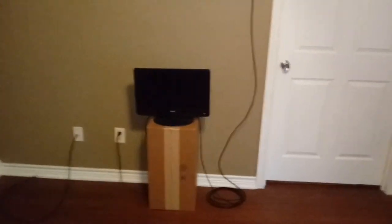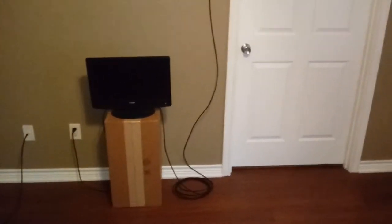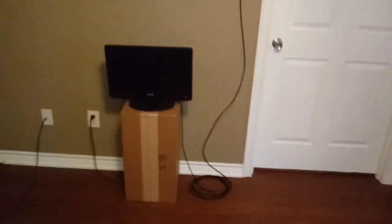The next tip is to check those websites I put in the description and re-scan for channels very frequently. The FCC is currently going through what's called a repack, because they are making room for bandwidth for 5G. A lot of stations are operating at low power while going through the transition to make room for the 5G towers to come in. Also, a lot of times television stations may change frequency, but if you re-scan you'll pick it back up. Re-scanning frequently will help you pick those channels back up, so keep checking back and keep re-scanning.